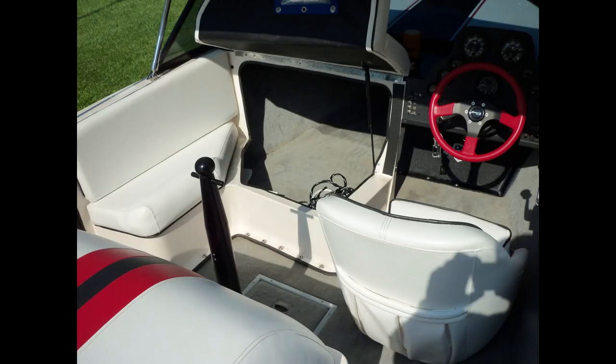And we mentioned earlier about two different types of modifying the L-seat, one with a bimini top or a short bimini top and one without. Here's a finished job from a couple of years ago in an Advance. This boat has a short bimini. Therefore, the modification is a little different. Only the back and main bottom will hinge up. The other bottom remains in place. And this one only gets one strut as opposed to two.